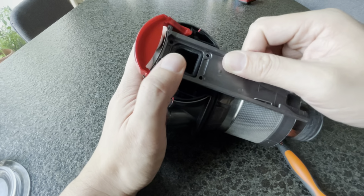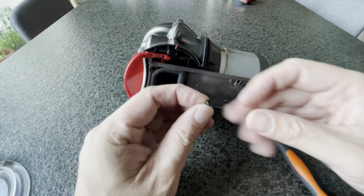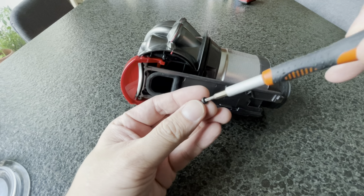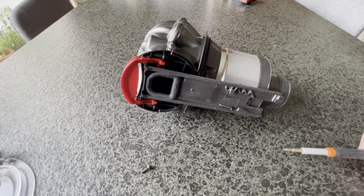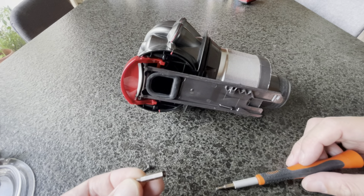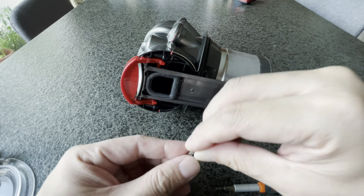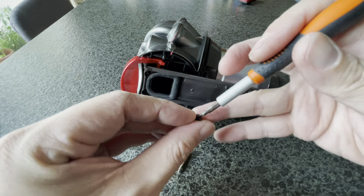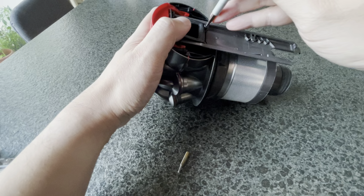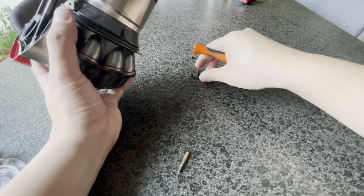No, it's wrong. Okay. And then you have 4 screws. These are slightly larger. These are T something else. T10 maybe. Let's see. Is this T10? T9. The T9 here. Oh yeah, it's T9. So these are T9s. Slightly larger than usual, and it's not a big deal. The T8s might just work if you don't use too much strength on it. So just gonna put this down.